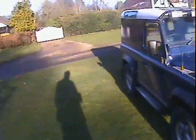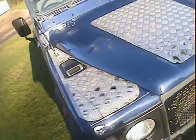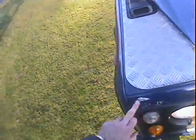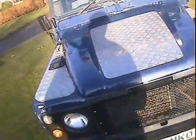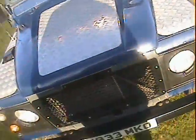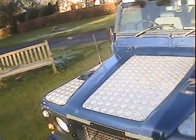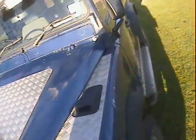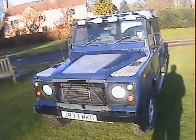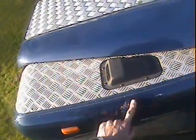It has been repainted and is generally pretty straight — not sure when it was done, prior to the previous owner's ownership. There are a few areas where the paint has come away. Around the offside light unit there's a bit of original paint showing through and it's very slightly dented — just slightly crinkled on the light panel. It's got a custom grille but the grille panel looks like it's off a slate grey one. There's a bit of paint loss just around there, and the eyebrow has lost a bit of its plastic — there are some spares available. A bit of paint loss on the bonnet edge. Looking down the nearside, it actually looks pretty straight apart from a couple of very slight dents here and a couple more up on the barrel side, which has also lost a bit of paint.